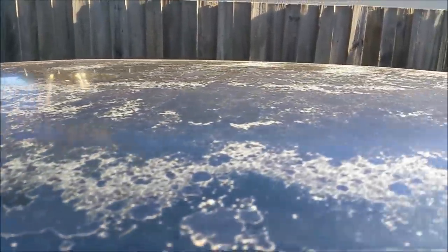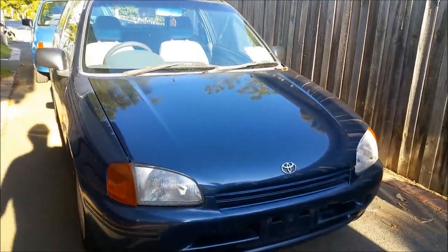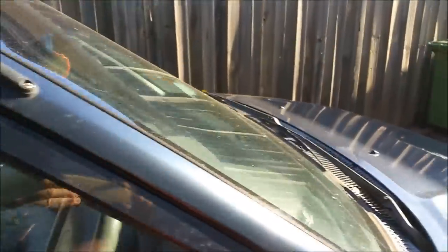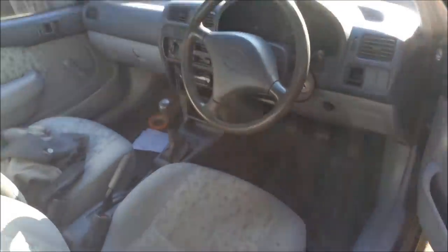So, now we've said all that, we can take a look at the car as it arrived a couple of months ago in February. You can see the clear coat on the roof is delaminated, and you can't do anything with that, you have to take it off. Now, the colour coat underneath was stable. I'm just going to shoot back to it now. That means that it can be primed over the base colour because that was stable. So that's what we ended up doing.